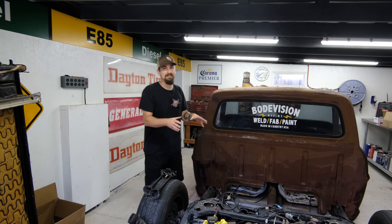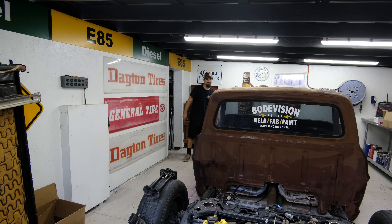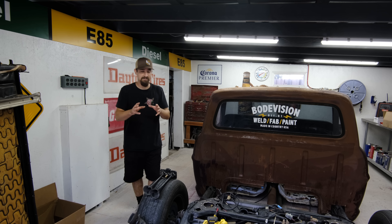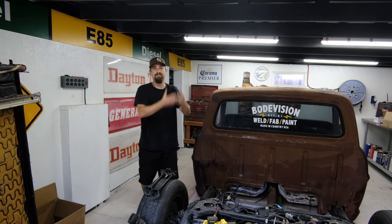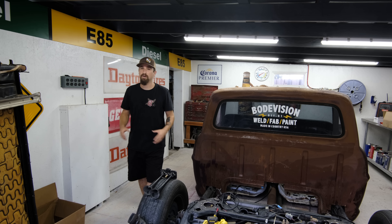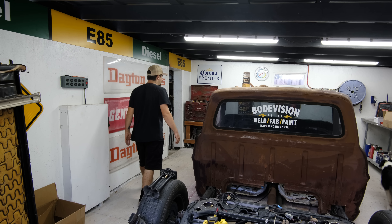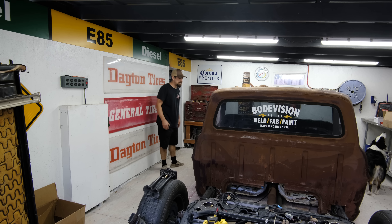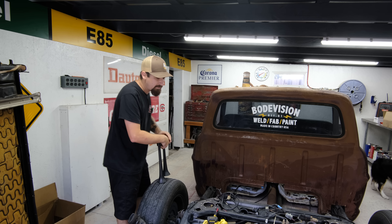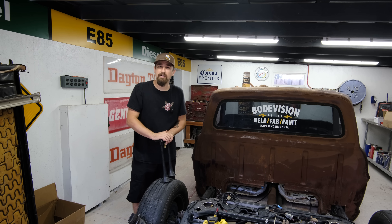Back at the shop — when we were out on the bikes I was hoping my last parts would arrive, but unfortunately they won't be here today. At this point we have all of the physical mounting of the bags complete. I like to think of a bag install as three different parts: first, the physical mounting of the bags; second, running all the airlines and plumbing the systems; and third, running electrical to control the valve so the airbags can inflate and deflate with a switch from inside the cab. This is going to be a simple budget system — no air management manifold. In the next video we'll be running all the air systems and electrical. Let me know if you have any questions about the physical installation.